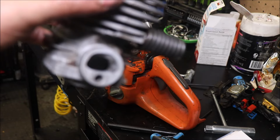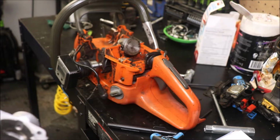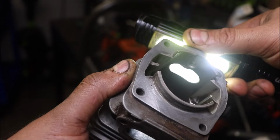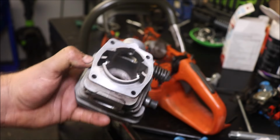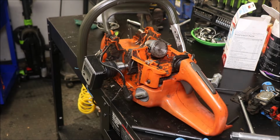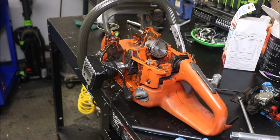Intake port, the typical deal I normally do. I did lower it what little bit you can. It is widened. As you can see, it's got a little bit of a shape to it. I don't go as drastic as some people, but it's my method of widening. It leaves, I don't know, maybe a bean looking shape to it. I just feel it helps angle things down into the case where it needs to be. People say aiming it into the transfers.